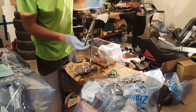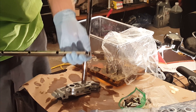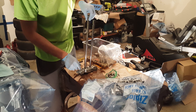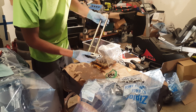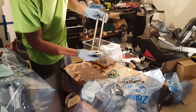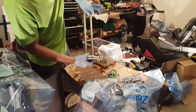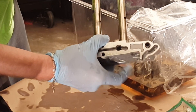We'll go ahead and place these in. As you'll see, there will be a thick end and there will be a thin one. The thick end goes in that side. Also you'll see how they're turned — when your VTEC system engages, oil is pushed through there and through this shaft right here, so you'll have to get these lined up so the oil is able to pass through.